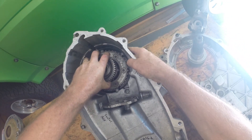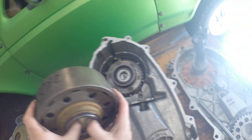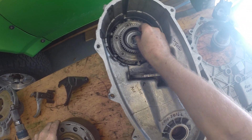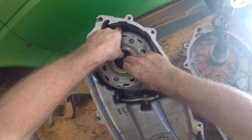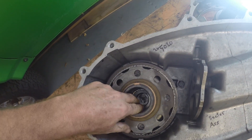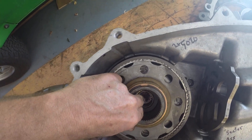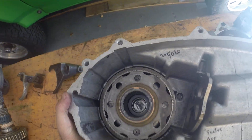Next, go in with the input shaft. Then go in with the ring gear. Actually, first put in the thrust washer — that's got to go in because it won't fit through this slot. Make sure you try and center that thrust washer so you don't crush it when you put the ring shaft in there.